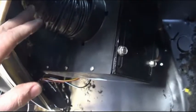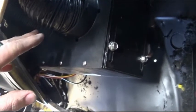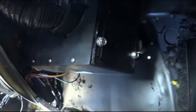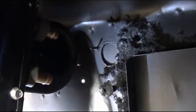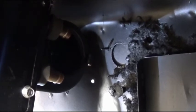Again, the ductwork is going to vary depending on your application, which size hose you get and everything. I'm doing something a little bit different with this because I'm just running straight defrosters. The hoses, as you can see, run off the back. So we're going to drill somewhere through the firewall, and we're going to determine on the other side of the firewall where, so we can route our hoses where we want them, to make sure they don't touch anything that could cut them or burn them, and to make it look a little bit prettier than just having them dangling around somewhere.